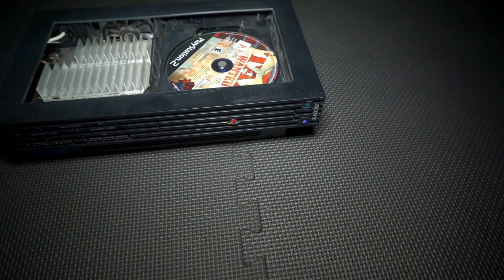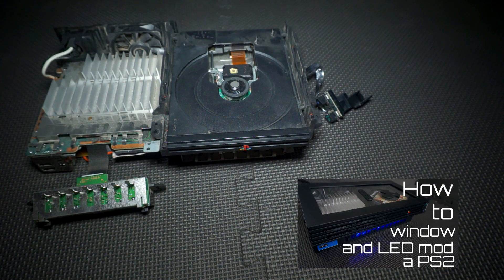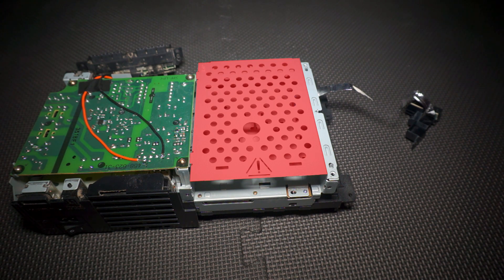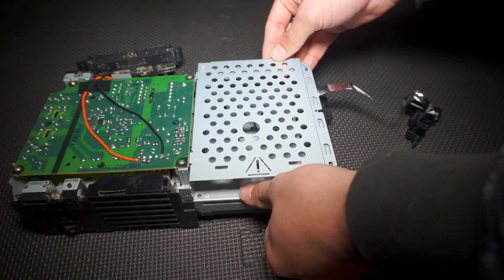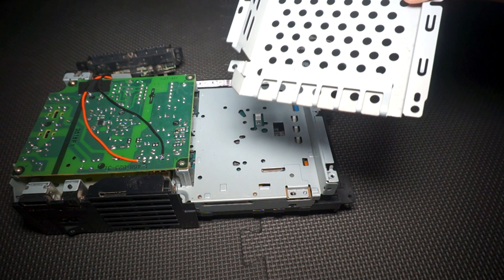Okay, so take apart your PS2. I'm not gonna go into this — if you need help, check out my last video, link is in the description. So once you're at this stage, I decided to remove this little metal cage as I didn't want it to get in the way of my LCD. You only need to remove these two screws and it pulls right off. In my last tutorial I had bent this front part down, which for this mod wouldn't be enough given the small amount of space. Okay, let's focus on the bottom shell.